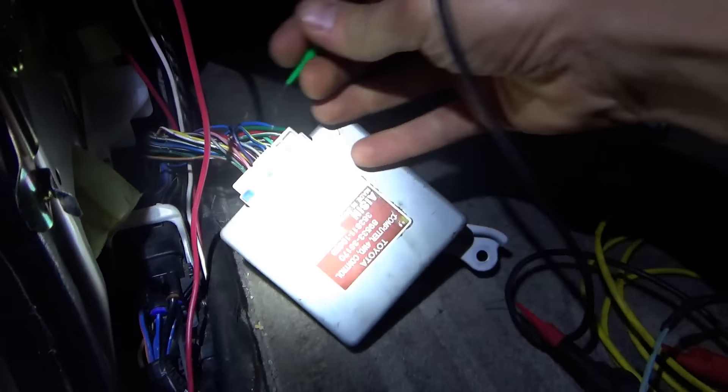I'm going to do the same for 4-high locked and 4-high free. Let's switch into 4-wheel drive. It went right in - we have the green indicator on. The front axle is locked in, the drive shaft is spinning but the differential is unlocked. In 4-high when the car is happy: TL1 is grounded, TL2 and TL3 are at 10.7 volts. The 4-wheel drive switch red and black was 11.7 before, now it's 10.9 - that's suspicious. You would think this would be grounded right now when you're in 4-wheel drive.